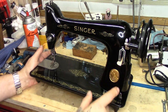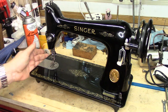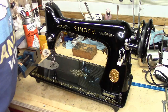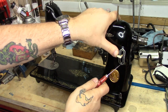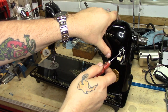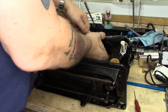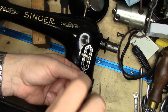I'll be happy to show you what's inside and how to get it apart and back together again. Let's get started by taking off the bobbin winder and the balance wheel. Now that that's out of the way, on the plate that covers the adjuster mechanism you'll see two screws — don't lose them, they're hard to replace. We need to get this off to remove the mechanism. I'm going to lay the machine down on her back, supported with a little block of two-by-three, and remove these two screws.